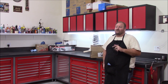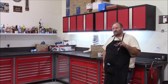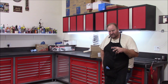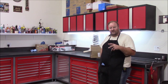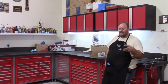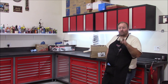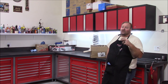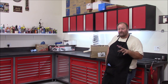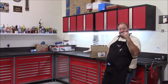When I did the suspension on it, I knew I was going to be building it and altering it. So I put a 4.5-inch BDS long arm suspension under it. I know people are probably saying that 35s on 4.5 inches is a bit much, but I knew I was going to be loading it up heavy with bumpers, winch, toolbox, etc. I don't have a lot of armor underneath it because I'm not a big armor fan, but I knew I was going to be loading it up heavy over the years, and I did. Over the years, it dropped a little bit.